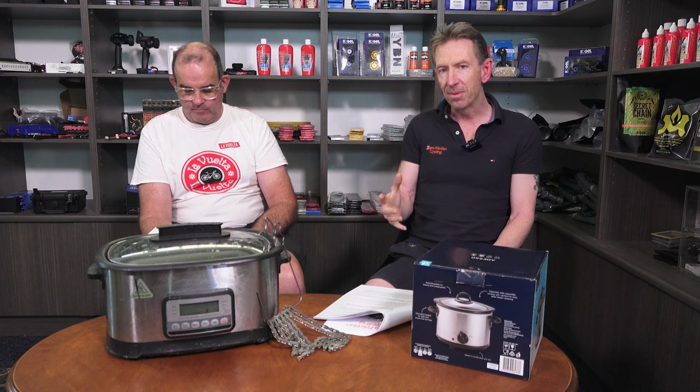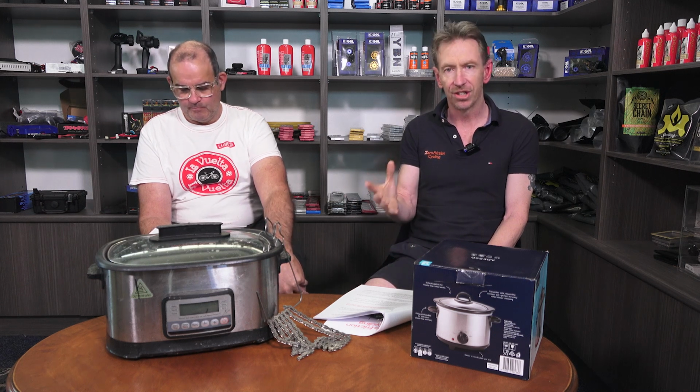So the key, if you're riding frequently in wet conditions, again, I bring it back to that multiple chain scenario. Just run 2 or 3 chains if you need to, and you're just going to keep your drivetrain and your chain super low friction, super low wear. Things are going to go so much longer than if you just apply a wet lube and just keep applying and keep going.